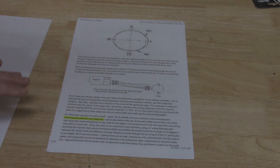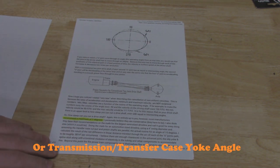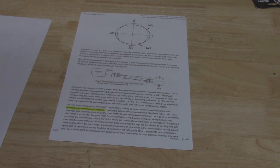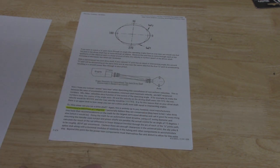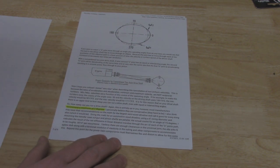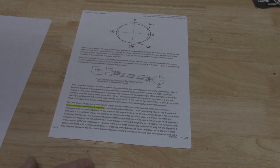This can be corrected by changing your pinion angle so you get the same angle on the transfer case side. Another cause of vibrations, even with parallel lines, is exceeding the maximum angle. Most manufacturers recommend a maximum of 7 degrees out of your U-joints. Go past that and you might experience slight vibrations, especially around 45 to 55 miles an hour. Go more and it gets even worse.